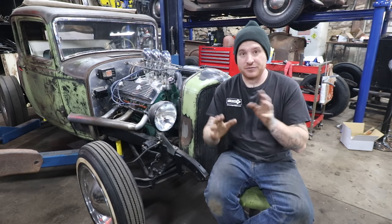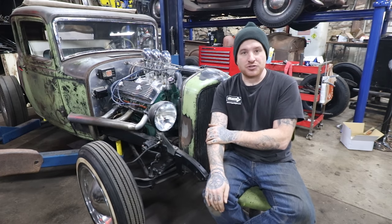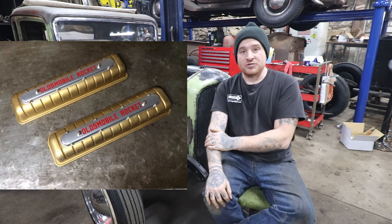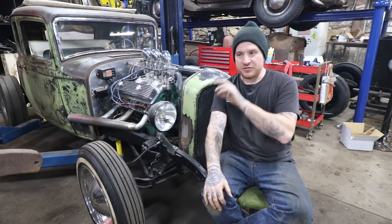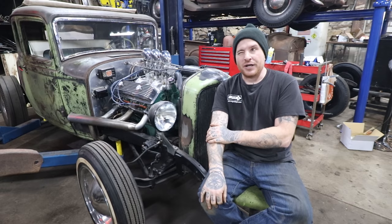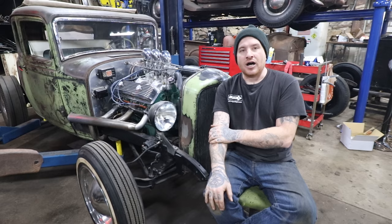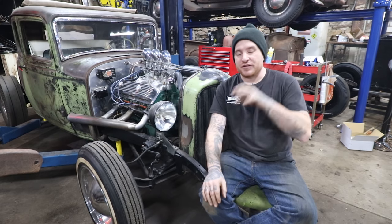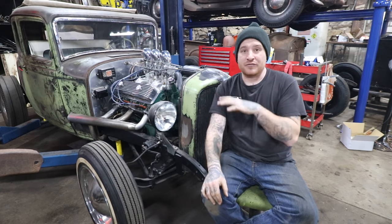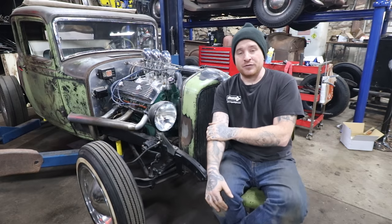The 49 to 53 303 Olds that you see is a really, really popular choice. They're very distinctive with the valve covers that you saw on those early Olds rocket engines. And in a lot of those photos you see that the 303 was used quite commonly. Now the early '49 to about '51 Oldsmobile engines, especially the '49s, have some small differences internally than the later engines. So there are some factory hop-ups you can do to those 303s that we'll talk about in a few moments.